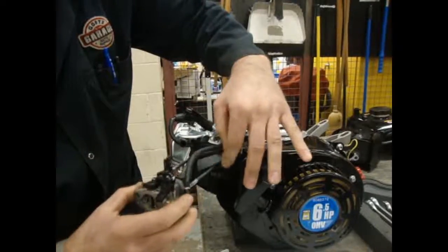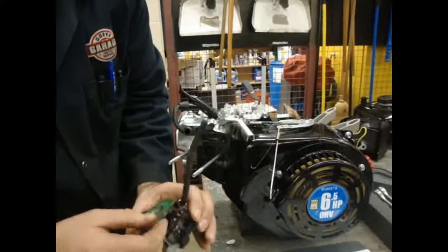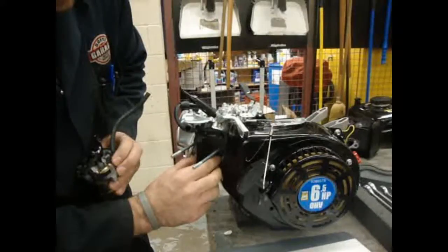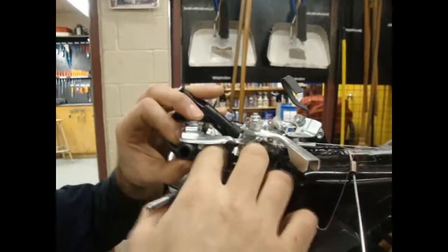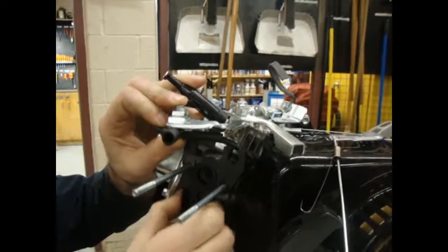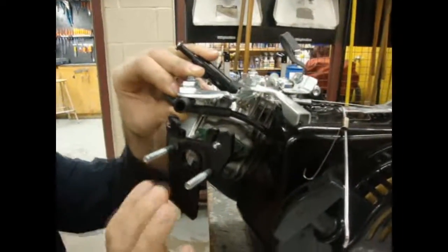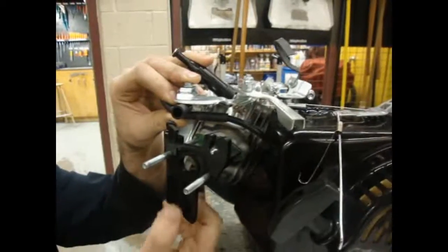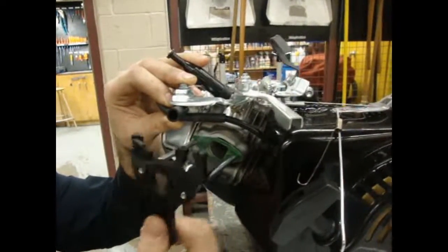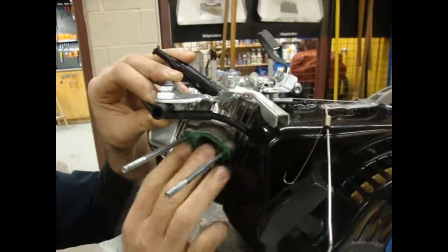Don't pull it — be gentle. I've got the fuel lines coming with it. This green gasket stayed on there, and it looks like it doesn't want to come off — I'm not going to force it. Then we have this spacer. The purpose of this spacer is so that it can route the different lines and rubber hoses, and it acts as a preventative to keep the heat of the engine away from the carburetor — it's a plastic spacer. It isolates the heat of the engine and keeps it on the engine side; it doesn't transfer it to the carburetor. The engine is mostly aluminum, the carburetor is aluminum — aluminum transfers heat really well. So we've got to remember the direction this goes on. And then we've got a gasket there as well — we can leave that gasket, it's not going to bother us.